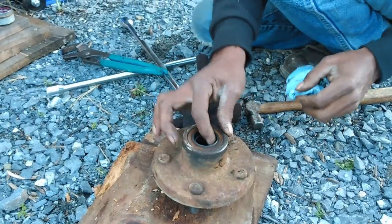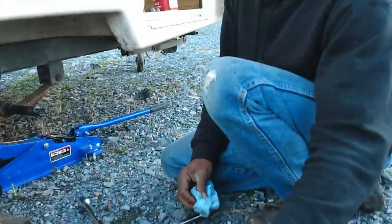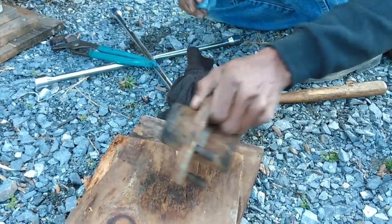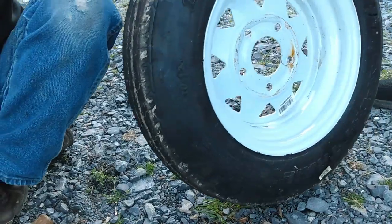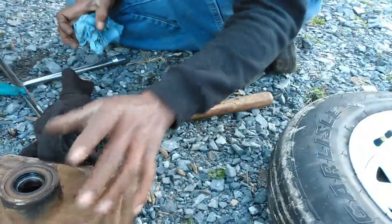I've seen some wheels with grease splattered on them. Is that what you're talking about? That would be in the back of the wheel. Some campers have brake shoes on them; this one doesn't. But if you see oil over the back side of your rim, slung around your tire, most likely the seal is bad, and you want to get that replaced. In that event, I would recommend you just get a new bearing set and seal as well.